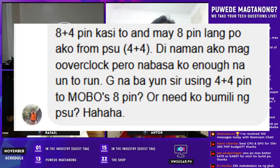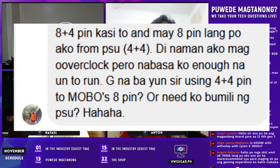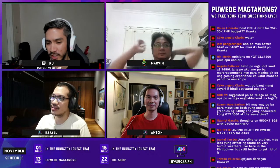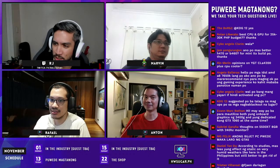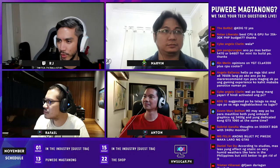Anybody else want to jump in with this? I just want to agree. Recently, maybe a couple of months ago, a friend, Raf, also assembled a PC, 3600, new B550. And then he was wondering how come his temps were so high when he tried to overclock simply. And then after a while, he did realize that he only had a 4-pin for an 8-pin slot on the motherboard. So yes, it does affect it that way.